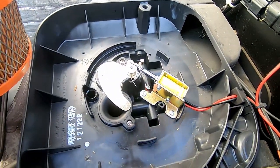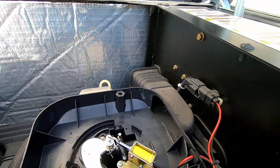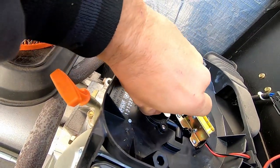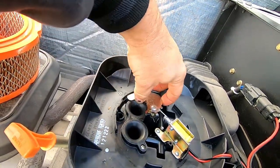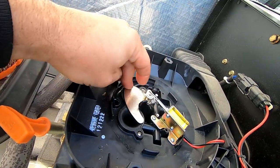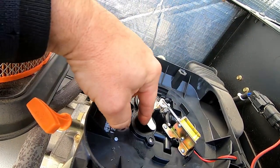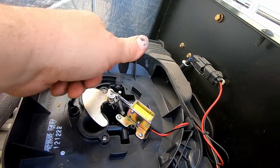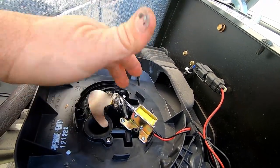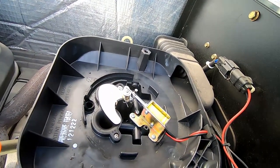We've got a little bit of oil in that one little pocket, which could be condensation. These have a tendency — you see how that's completely smashed down — you want to raise that just a touch so that it just clears. What'll happen is when it's really super cold, it'll freeze in place. It's just a lightweight little solenoid. I do that to pretty much all of them and it basically helps it start in winter.